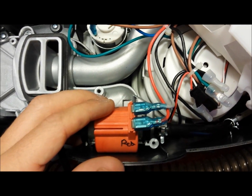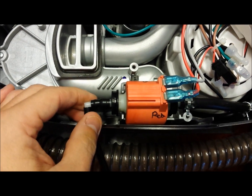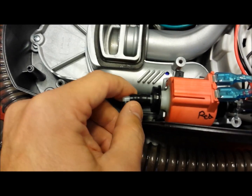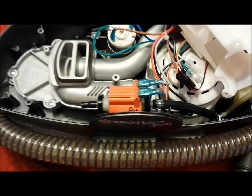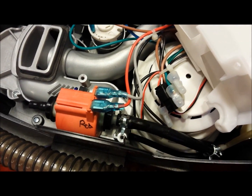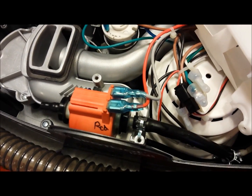The pump sits freely in a plastic bracket. To get it out, detach the cables — these are not clamped or pressurized, so you can just pull on them. Remove the little Y connector by pulling it off. The other side has a clamp like a smaller version of a cooling hose clamp in a car — use needle nose pliers to clamp it, slide it down, and pull that hose off. Disconnect the electrical connector as well.